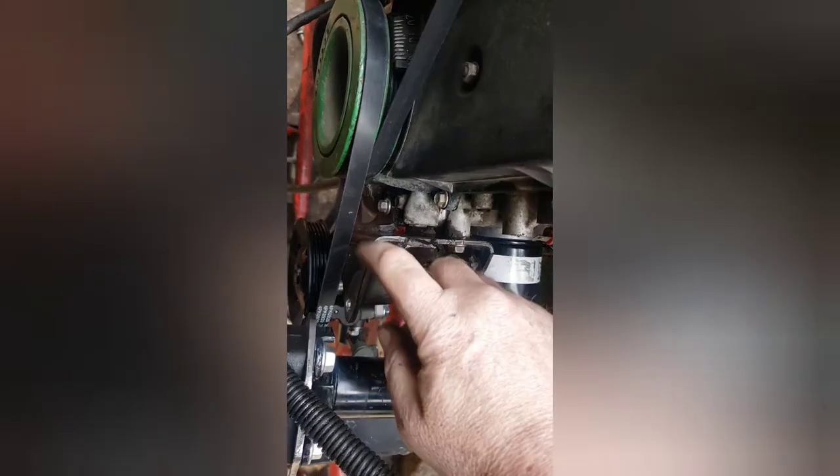There it is — there's the pump, here's the original power steering bracket that I've been modifying to work on. Eventually the air conditioner will sit there and I'll put an idler here that'll do a full wrap around the crank pulley, come back, double back, catch the power steering, go up, catch the AC compressor — which is now my air compressor — and come back over. And I believe that is going to work out just fine.